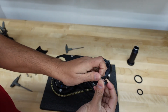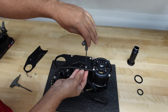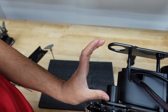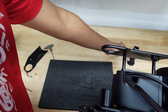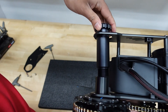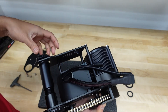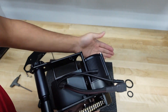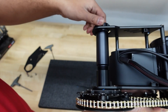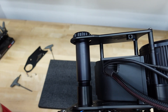Okay, and the last step is to install the clamp back on. That's it — now check it out! This motor is now set up for 120 millimeter, so you can put the larger spindle and larger left bottom bracket cup and you're good to go. These two spacers will come into play when you're actually installing the motor on your bike, to space it out more on your bike, so these two will come in later. That's it, guys — hope you enjoyed this video and it helped a lot. Let us know if you have any other questions, and we'll see you next time.